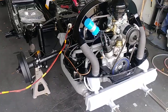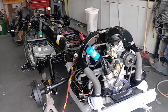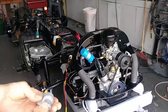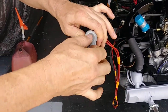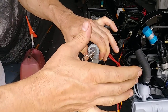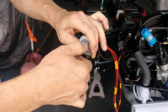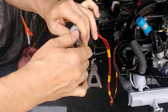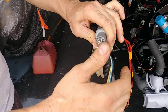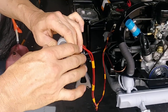My son Henry is going to change places. Basically it works just like the regular VW starter — you have your accessory position here, that's for the coil on. You can't leave that on or you'll burn the coil up, and it'll burn the points up.